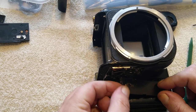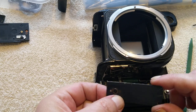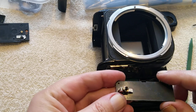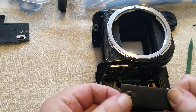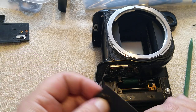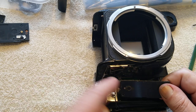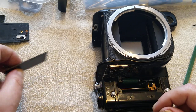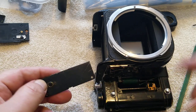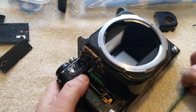This just lifts straight up and comes out. This is metal, those are plastic. There's a mirror lockup lever on the back there. The reset — don't forget if you're going to use the reset, hold it in and push the shutter release. I've seen a lot of people who push the reset in and nothing happens. It flips the mirror up but it doesn't reset the second curtain.